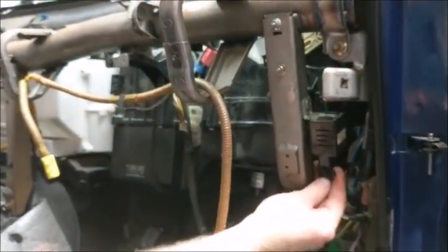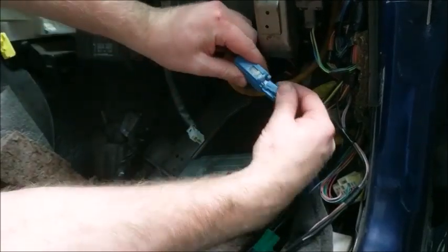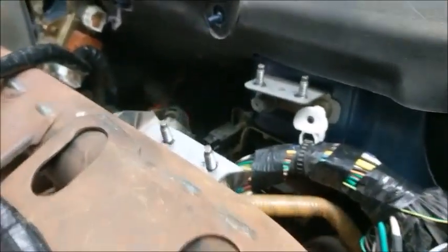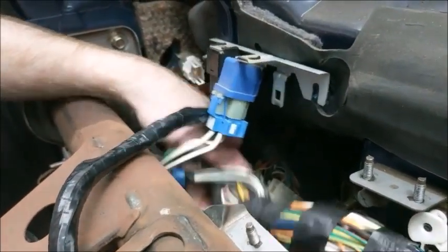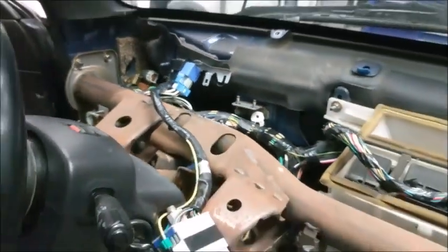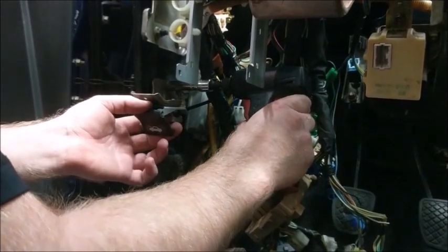Connect the black plug into the black box. Tuck the airbag plug and connect it to the matching blue plug. Connect the black plug. Working on the driver side, attach the plastic hook and hang the bracket on the bolts to keep it in place for now. You'll also secure the bottom of the wiring harness to the top of the fuse box. Undo the bracket for the hood latch — the harness needs to go in between the cable of the hood latch and the wall.